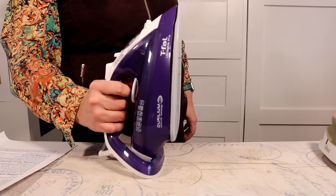How does distilled water actually cause the leaking? Distilled water, because it's pure, has a higher boiling point than tap water. So if you do not wait for your iron to heat up to that higher temperature, you may have leaks. As well, our irons work with a thermostat, which means that the element in the sole plate heats up till it reaches a high limit temperature, then it turns off and cools down until it reaches a low limit temperature. So if you've caught your iron when it's cycled off and cooling down and is in that lower temperature range, it will take longer for your iron to heat the water in the steam chamber to that higher temperature where distilled water boils.